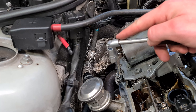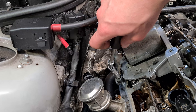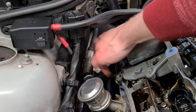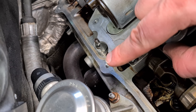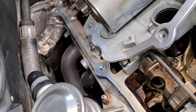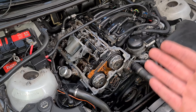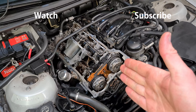Now we have to make sure the valve cover bolt screws in all the way to the aluminum part. I have the bolt back in and I'm going to try screwing it in by hand to feel for any resistance — and yeah, it's loose now, so I can definitely screw it all the way. This should work now. I'm going to let it cure for a couple of hours, then continue assembling the engine and put the bolt back in. I hope this will work. This is the end of the video — I hope you find it useful if you have this issue. Remember: keep zen and just continue the art of BMW maintenance. Subscribe if you find these videos useful.